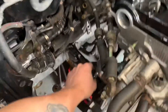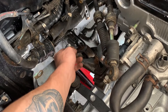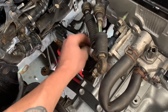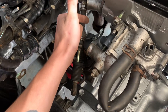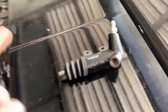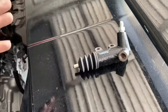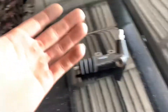It's another braided cable but it prevents flex from destroying the integrity of this cable from the engine moving back and forth from driving, because poly mounts. I'm going to get the other line and I also have to find a bleeder replacement, because my transmission didn't come with a slave cylinder on it so the bleeder wasn't on the slave cylinder. Most slave cylinders just have the bleeder right there, but this one actually has a line that comes off and then the bleeder, so you can hold it up in the air when you bleed the system.